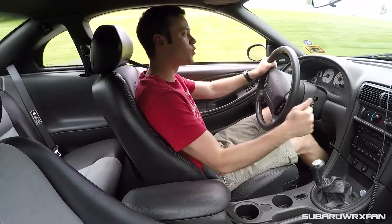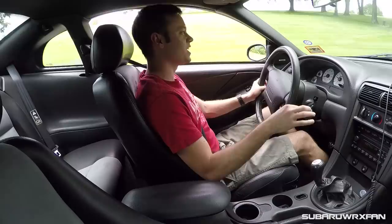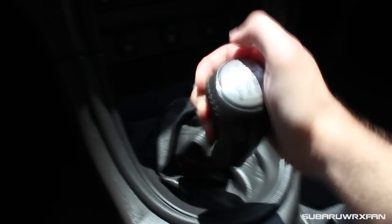With my seat as far up as it is, this manual transmission is still a little bit of a reach, especially for first, third, and fifth gears. The Tremec T45 is pretty famous for being a pretty tricky transmission. It's strong and takes a lot of muscle to use — even in neutral it doesn't wiggle freely; you have to put muscle into it. So it's a very tight shifter. The owner has a Steeda short-shift kit in here as well, which makes it even more tight and snappy feeling. The gears are very closely spaced together, and it certainly takes some muscle — but for a muscle car of this generation especially, it's something you just come to expect.